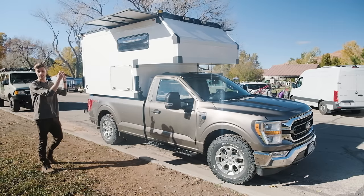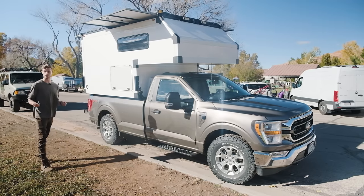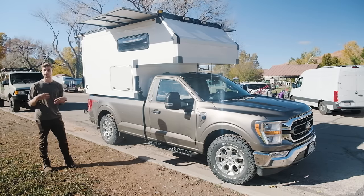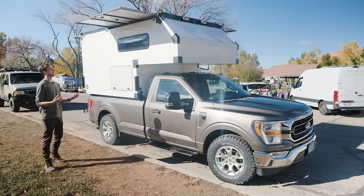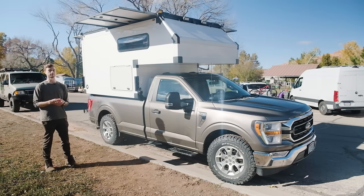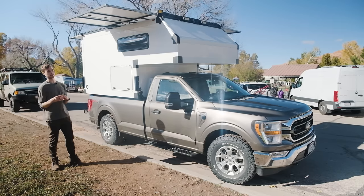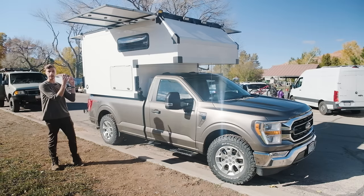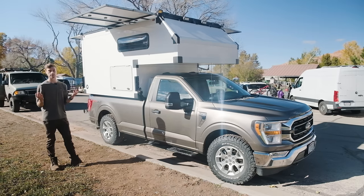There's a set of drawer slides on each of the panels, just like you would use for, I don't know, a 40-inch drawer in your house. And then there is a 40-inch linear actuator for each panel. Those actuators are hooked up to the relays, and you can control them from your phone, just like everything else in the van. The actuator is electric, it goes in and out. The framing itself is aluminum extrusion tied into the solar panel. We used the upper layer of solar panels to build the frame, and the aluminum extrusion is only in place where it absolutely needs to be in order to save on weight.